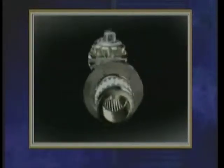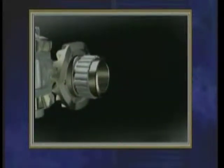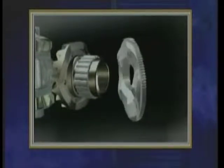One of the side gears has cam ramps machined on the back face. These ramps align with corresponding ramps on the cam plate. There are 4 protrusions, or detents, on the cam plate, which mate with 4 holes on the side gear. This prevents the cam plate from ramping until a predetermined force, or torque, is applied to the gear teeth.